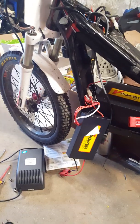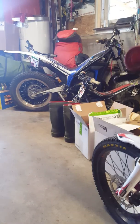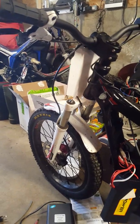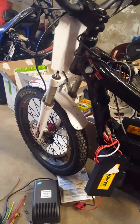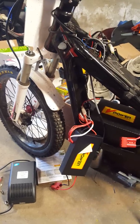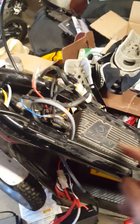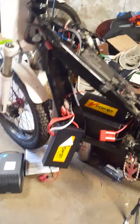The other bikes have used K2 batteries — I did a video on those — which were 24 volt, 10 amp hour batteries and I just put them in. I put some separate leads on for charging, bypassing the OSET ones, because it goes through the controller and everything for some reason.